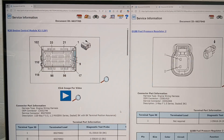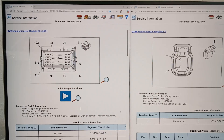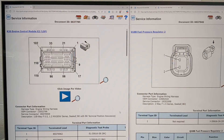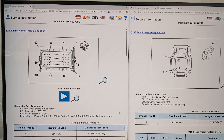In our previous video we tested the fuel pressure regulator number two circuits using a DVOM, a test light, and control functions in the scan tool. You can see the test light at 80 percent duty cycle is brighter, and when we knock it down to 40 percent duty cycle you can see the test light intensity decrease - you can also see it on the DVOM and on the scan tool. That's a pretty clear indication that we had control over that regulator using both of those circuits.